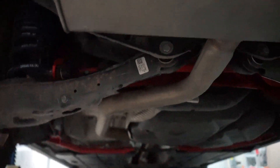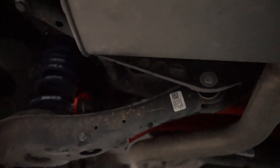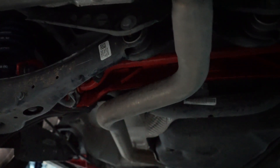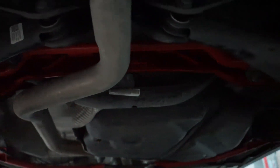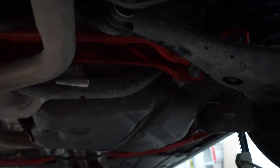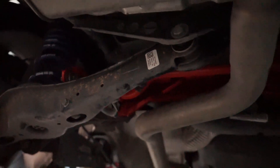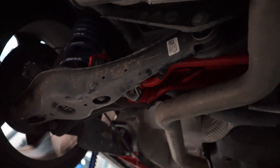My plan worked — not without a little bit of muscle behind it, but there is the rear subframe brace with our sway bar brackets attached on both sides. You can see the rear subframe is basically this bit right here and it just creates a new mounting point. It should provide a little bit of extra rigidity to the rear end. Pretty happy with the way it installed — I like that they give you the bolts and everything, and this should work out well as far as strengthening the chassis goes.